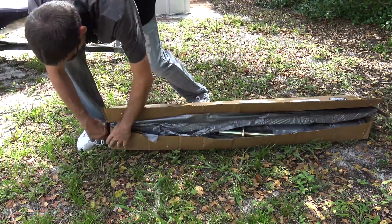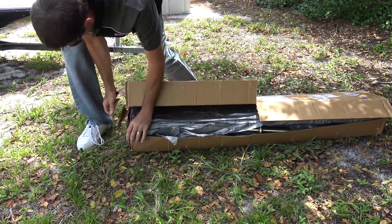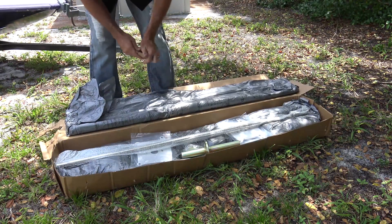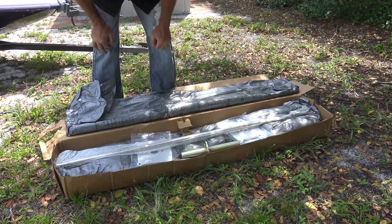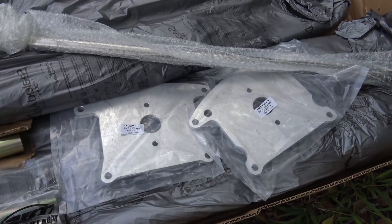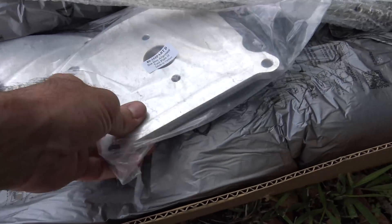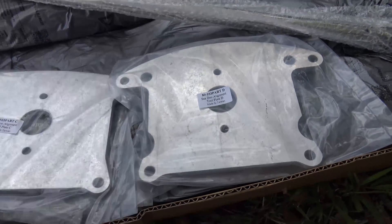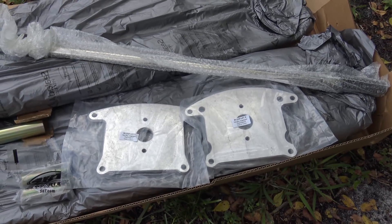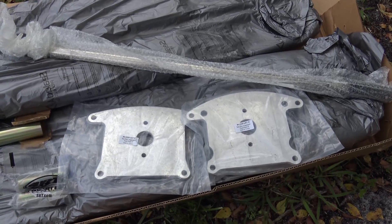This thing is really packed tight with staples. So the 80-103B alignment tool — let's show you what's in this. In the box: two plates. These plates are going to align where your pump is. You've got to take your pump off your jet ski. These are labeled plate C and plate D, with slightly different bolt patterns to fit the various models from 91 to 2009. That's going to bolt up where your pump usually bolts up.